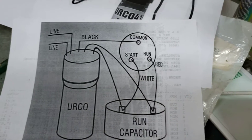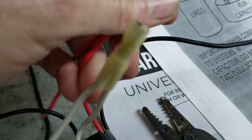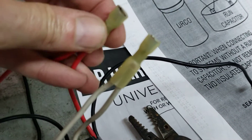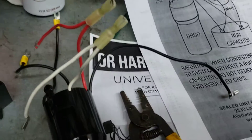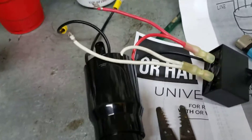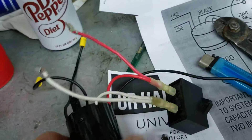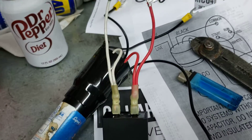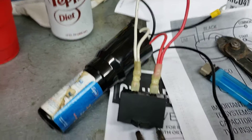Between the red and the white wire — you can see what I've done. I've cut the red and white wire, twisted them together, put the connectors on, and put a good crimp on them. Now I connect the capacitor and wire it up to the fridge and we'll see if it works. Got it crimped, got my wires on there, so now I can hook this up to the fridge. Conversion is done — let's plug it up and see how things go.